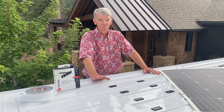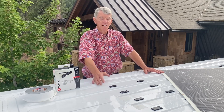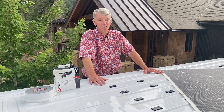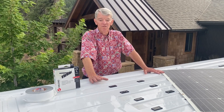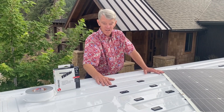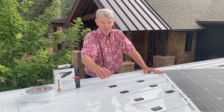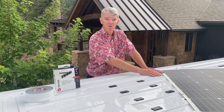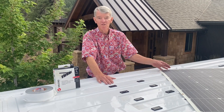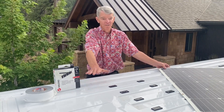When I went to mount the solar panels I got a lot of different suggestions. I didn't want to drill any holes, but there are different ways of gluing. What I've come up with is using velcro — little dots or stripes on the roof of the van that the solar panels get mounted onto. That gives me the advantage of a little bit of airflow or an air gap underneath the panels. The suggestion is you want an air gap so they can get airflow and not be right on the surface of the van, which can get hot and transfer heat into the solar panels.